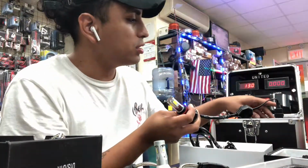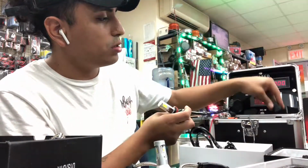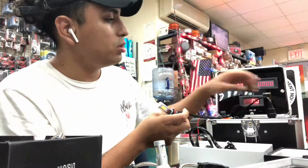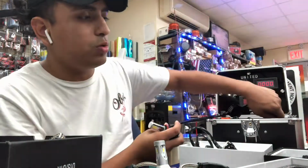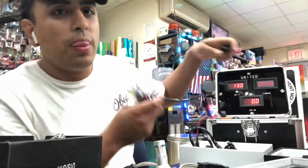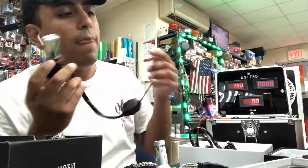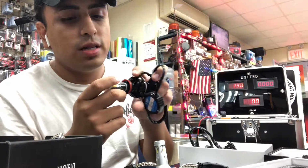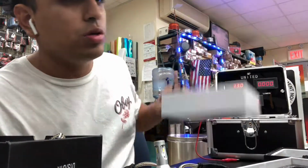So you can actually see here when I turn it on, the lumens are presented here as such, and the wattage. So these are 3,000 lumens initial, which is what we promote them as. Like I said, as soon as I turned it on, I feel the hotness. These are COBs. These are old technology. Like I said, people love these, but the thing with these is that the circuitry is on the outside of the bulb, very easy to damage or to come loose. So those are the G5s.